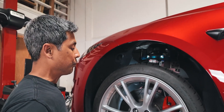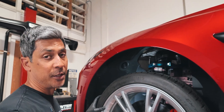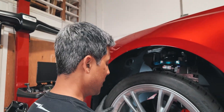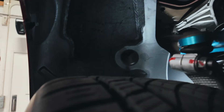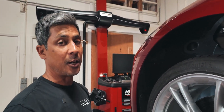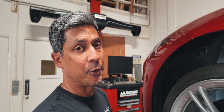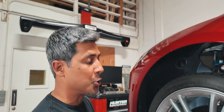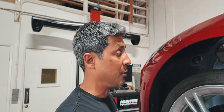All right, guys — so we got the Gemini wheel on there. We have no spacer on this currently, but we do have a two-piece rotor, so it's as if you've got a five-millimeter spacer on your factory performance rotor. Now check this out — this clearance is super, super close. If you did not have a two-piece rotor or a five-mil spacer on there, I do not believe it will clear. So this leads me to believe that this knuckle, backspacing-wise, really isn't different than the other one. There are some other differences to accommodate other sensors, but the actual shape and dimension of the upright appears to be the same as before.